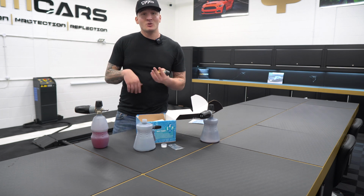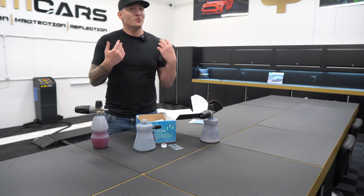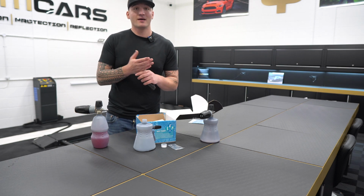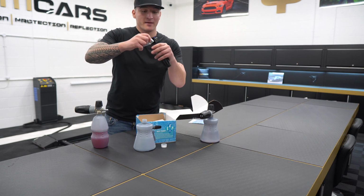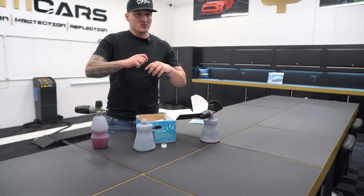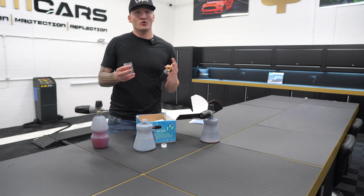So like I said, if you do have, let's say, a Nilfisk, or you've got a Karcher K2, K4, K5, any pressure washers like that, it's a very simple fix. You just take a screwdriver, you literally unscrew it, you put a new one in, again, screw it, only do it with hand tightness. It's quite easy to cross-thread this, so just put it in, just give it a bit of juice behind it, just make sure it's nice and tight and you're good to go.